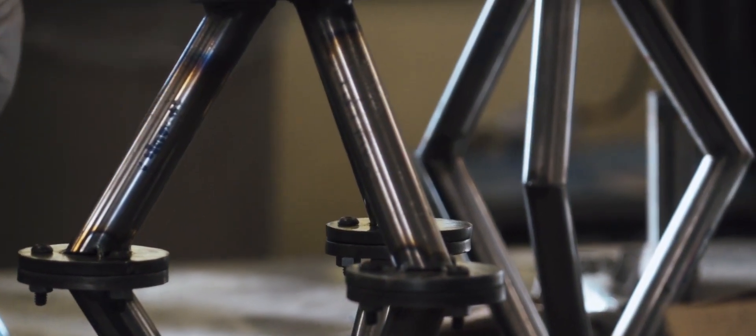Another test we're running is the difference between bolted joints versus welded joints, so that we can look into subframes. We do have an engine subframe this year, and when we move towards monocoques and everything, it'll make validating that data quite a lot easier.